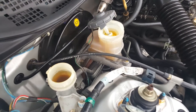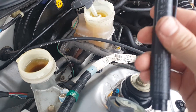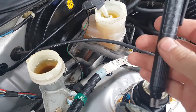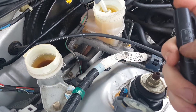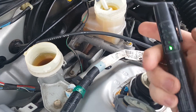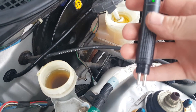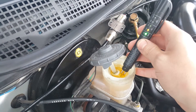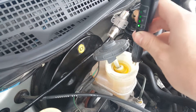Welcome back. I've got the brake and clutch fluid tester here — you can use it for any brake fluid and clutch fluid across all the DOT grades. So we click the button on the top of the pen which gives you a green light, then take the bottom cap off and put the two probes into your fluid. Mine is reading two percent, which means the brake fluid is okay.